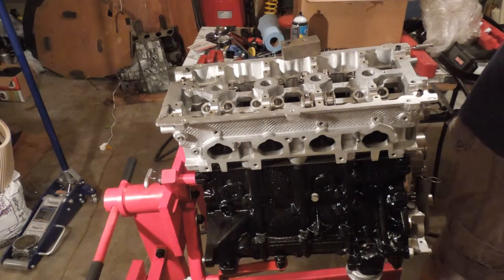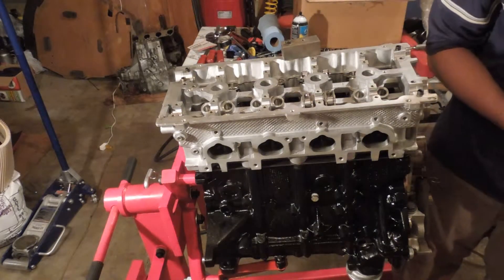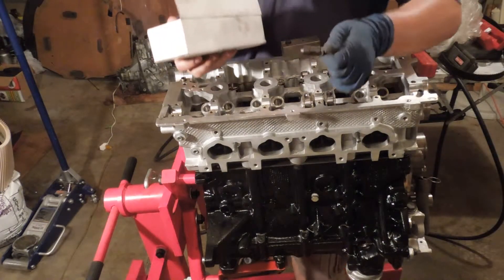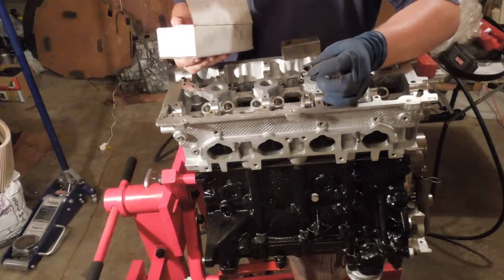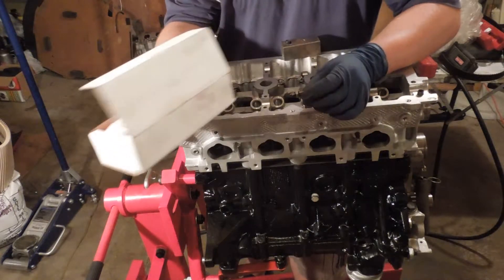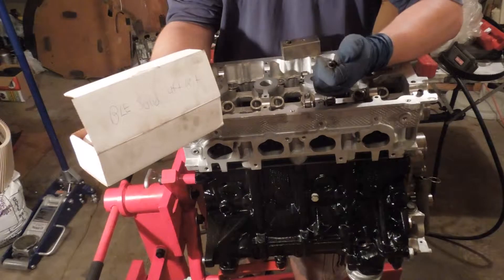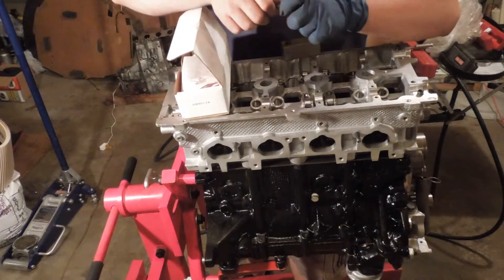So now I'm going to take all my solid lifters. This is a kit for an SRT-4 head, but they are actually identical. So this is your solid lifter — it's not hydraulic. This is coated for anti-galling on top, and it's aircraft-grade quality steel, so it's an alloy. Basically you adjust it up and down and then lock it down.